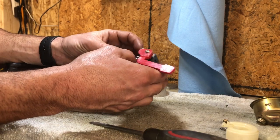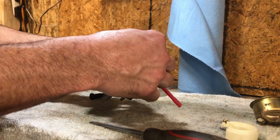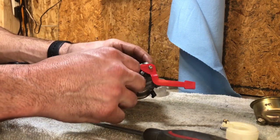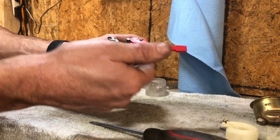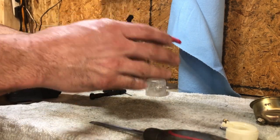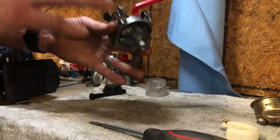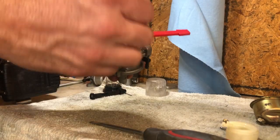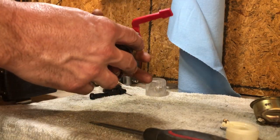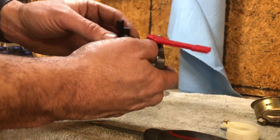Where I left off: you just want to make contact to the throttle lever, and then usually about one to maybe two turns should get you somewhere in the ballpark — and that's with almost a lot of carbs, somewhere within that spectrum. You don't want to go way in and hold it open, because you start that thing up and it's going to be way high. Make contact and go one to two turns — it usually works pretty well.